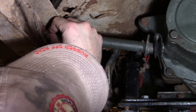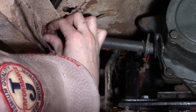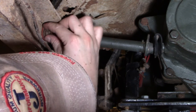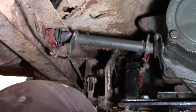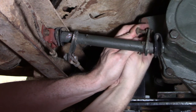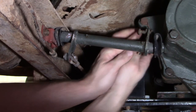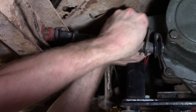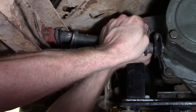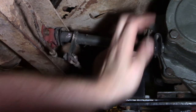So next up, take that clutch pedal shaft assembly and install it into the frame, as we're getting pretty close from an engine and transmission standpoint of being where it's supposed to be in its home location. So there's a pin which goes through the clutch linkage fork into that shaft assembly, which can be kind of a pain to install if it's not fully in the right spot, but you know, after you work with it enough, you can get it.